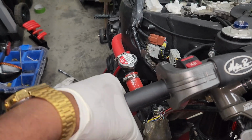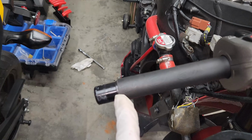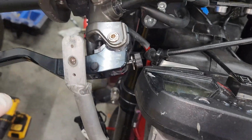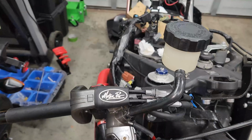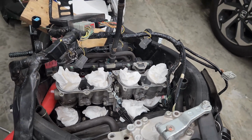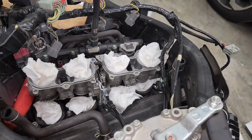Yes, sir. Crispy. Throttle return after shortening it. It was a very uneven cut. See how big this housing is, and I really don't want to have to scoot this over anymore. Matter of fact, I might shorten it even more so I could slide it over some. Now follow your manual. It says to adjust down here first. I think I'm happy with that adjustment down there, and then I need to adjust the return one.